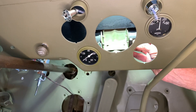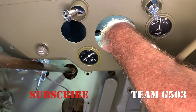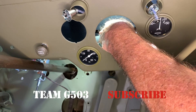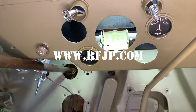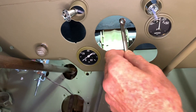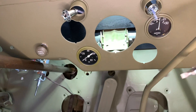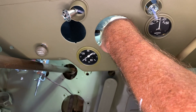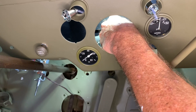It's nice to be able to reach in through the speedometer opening. I'd like to thank all the new subscribers here at Team G503, and thank you for the support of Ron Fitzpatrick Jeep Parts and Joe's Motor Pool — all parts seen in these videos are available at www.rfjp.com. To tighten down, I use a small box-end or open-end wrench through the speedometer opening, with a magnetic screwdriver making it easy. Now I'll go underneath the dash to show you how the ammeter looks with the bracket.